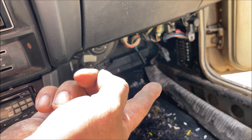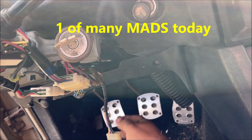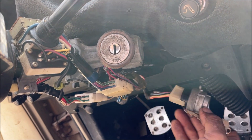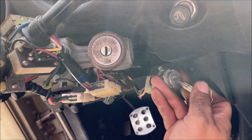It has an ignition relay over by the fuse box. Finally I got mad and started taking it apart, and I realized there are two ignition switches — one is the lock and column, and then there's your actual ignition switch. You can pull it out from the back with two screws, and this is all you need to start your car if you're messing with an old one like mine.